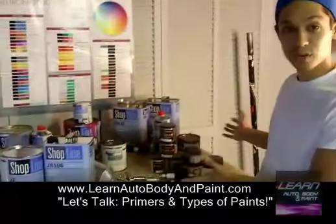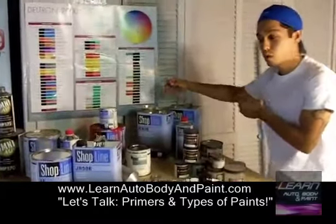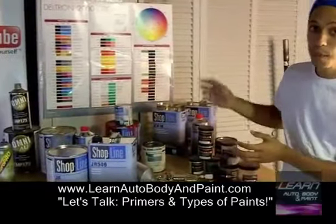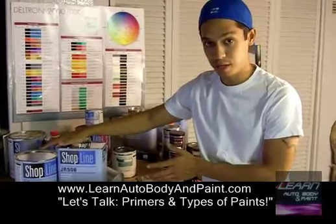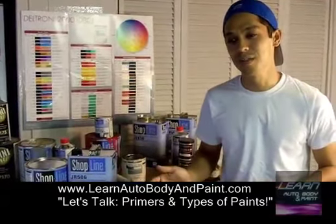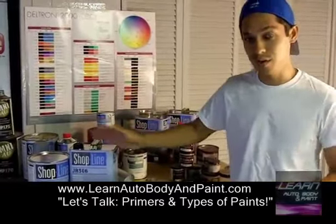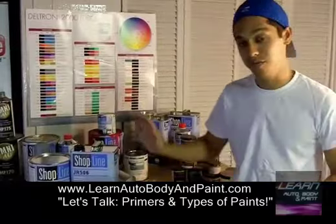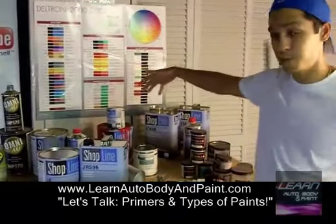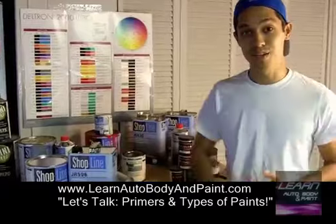That's the overview of the paints. I hope you kind of got an idea of what you could do. Remember, you can put pearls and flakes into the base coat clear coat systems, or if you wanted to add clear to the synthetic enamel or acrylic enamel systems, you can mix up your clear, put your pearl in it and do the same thing. Base coat clear coat is the newer style — they've been doing it on all new cars for about 14 to 15 years. Lacquer is a very old type of paint, then came the enamel systems, then we got into base coat clear coat. I hope you enjoyed this presentation — I'll see you on the next video.